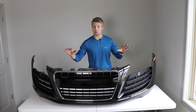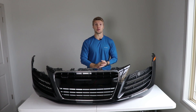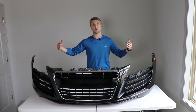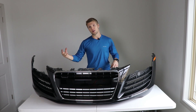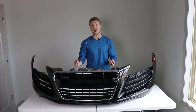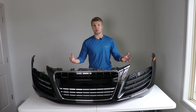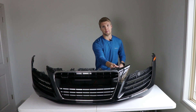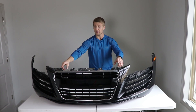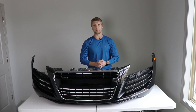We are out of time, so we're actually going to wrap the front bumper in the next video — but we wanted to make this video to show everyone, especially anyone on YouTube looking up how to remove the front bumper of an Audi R8. Here's a quick recap: get your three bolts in the fender wells, then the two hanging bolts, then the seven bolts on the underbelly. Make sure you get those two push pins — push the center out and pull the push pins down. After that, go across the top and loosen the ten bolts. Then you can pull the bumper out. There is a small grabbing area — almost like teeth — that wants to grip these two pieces, so make sure those aren't grabbing when you pull.